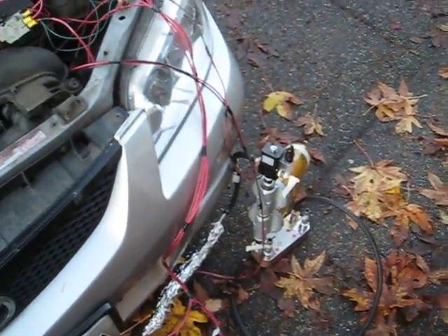Battery's almost dead, so let me just quickly go grab an ice pack and I'll quickly cool that off to show you how it goes back on. It just went back on itself — I heard it click. See that? Went back on — red light's back, so that's just because it cooled down enough, and now the heater is back on. So that shows you how the high temperature works.